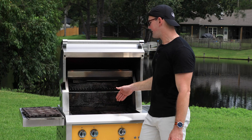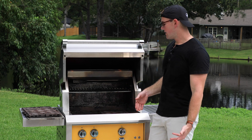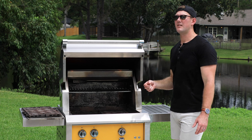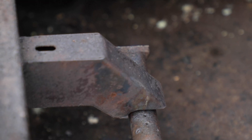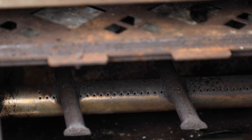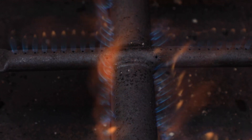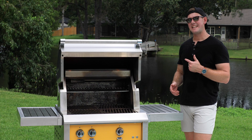The last feature inside the grill is the igniter — the ignition system. Most people are accustomed to spark igniters where you push it in, hold the button and click-click-click until you get that big whoosh and the tubular burner lights up. Heston uses a glowing rod ignition that heats up inside, so you don't have that rapid clicking and you don't have that massive whoosh when the burner lights.